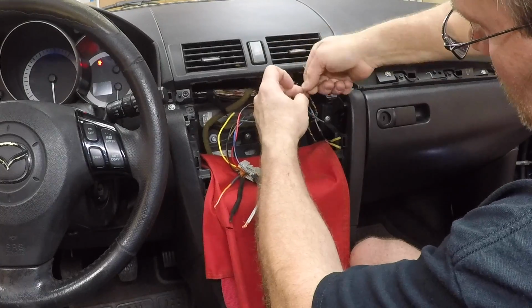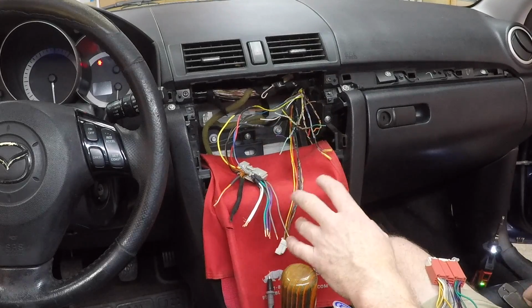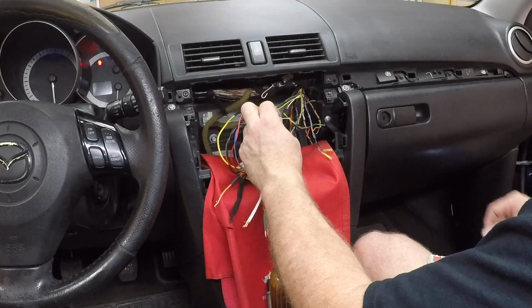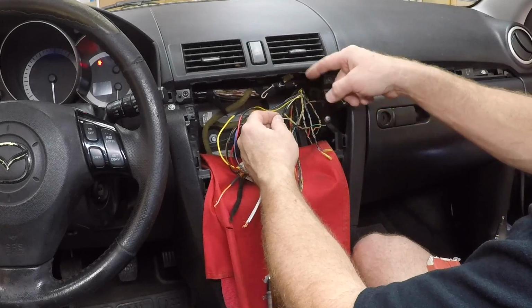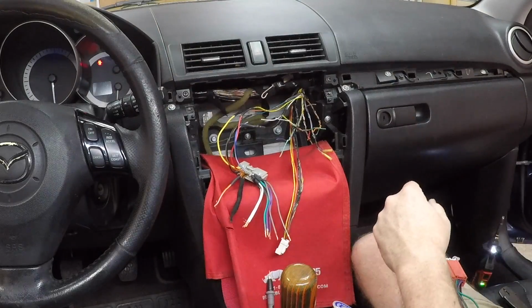We're going to break these into their pairs first. Now, you could find these using a tone generator by powering up the remote turn on and then tapping on one with one side of the tone generator and working your way through the harness until you get just one side or the other side playing.